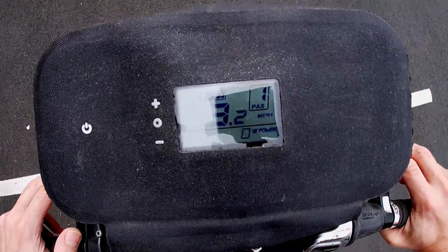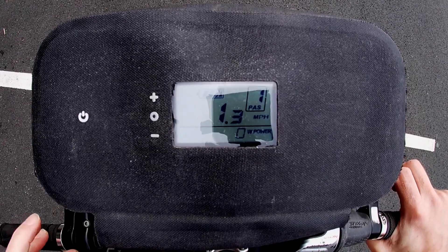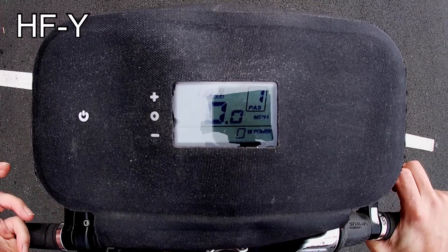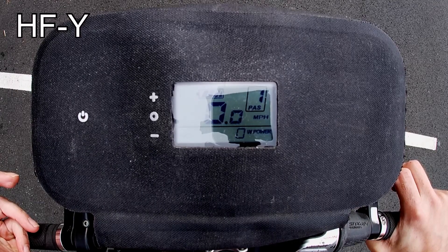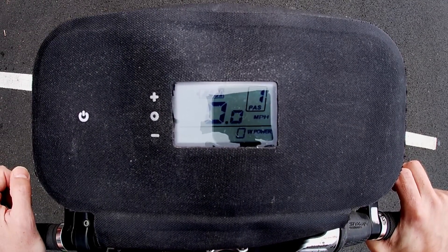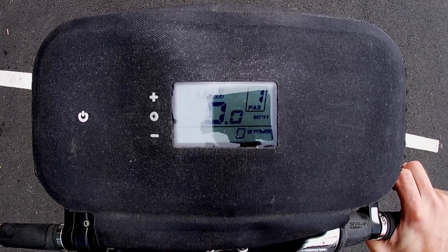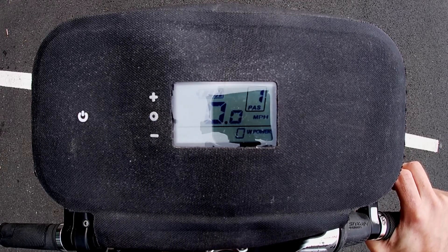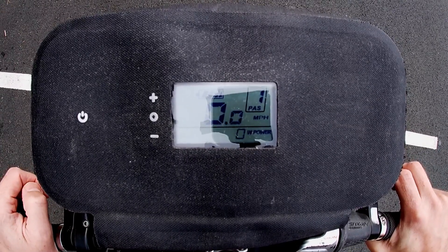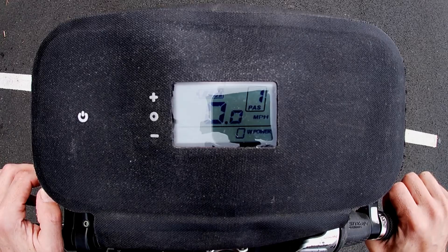So really depending on how you want to use it — if you want a quick boost and you want all the power, that's one option. But I think you're better off with the other method, because if you're going up a hill and you want a bit of power and you're only going 10 to 12 miles an hour, pick a pedal assist mode that matches that and you'll find it will be much better on battery. As soon as you hit that speed it's going to lay off and use less wattage. Whereas on the throttle max mode, if you're not doing 19 and a half miles an hour going up that hill, it's using maximum power and it doesn't need to. So I hope this helps — thanks very much for watching, please like and subscribe.